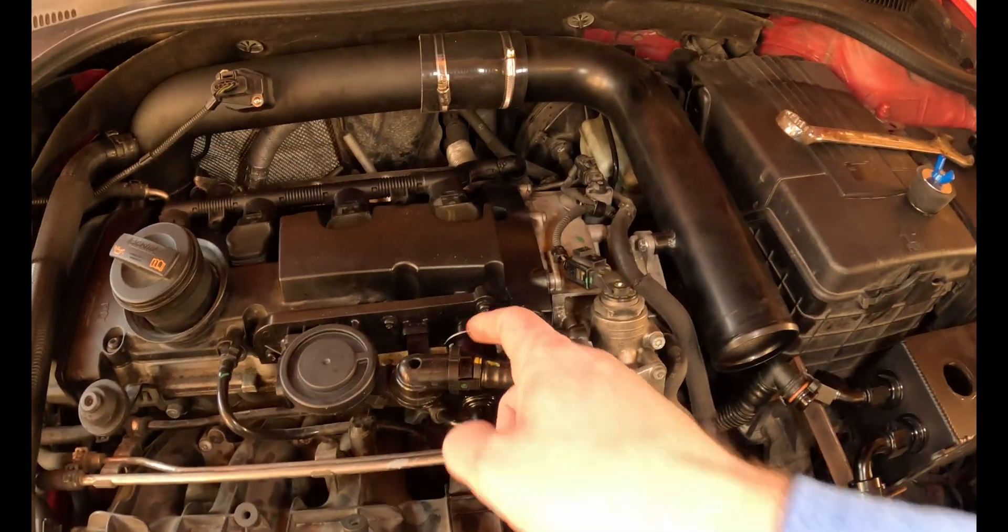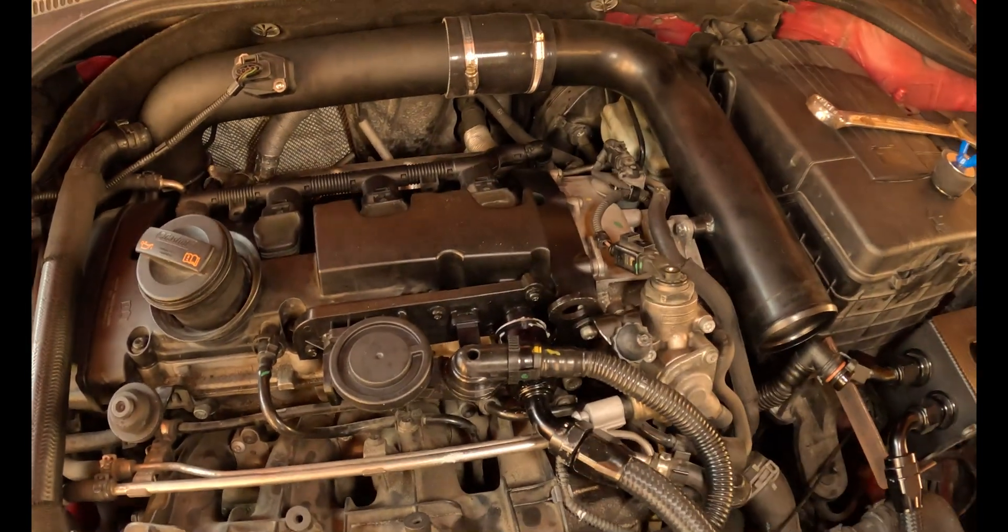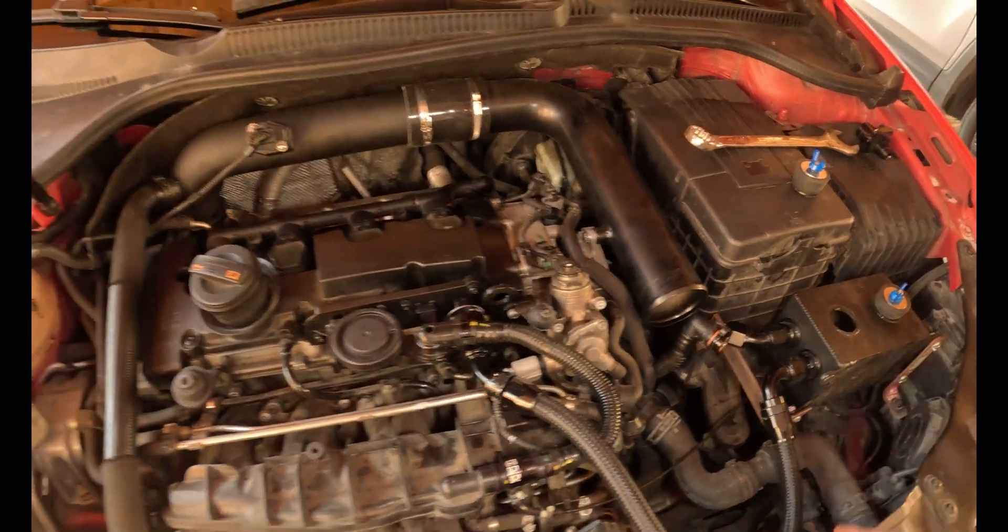That's why I came up with the little adapter idea — the one-inch fitting chopped down to a dash-10 — made it much simpler. If for some reason I ever wanted to revert back to stock, all I have to do is pop this off, route this line back up through right here, pop it back on, and literally detach and sell the can — no problem.